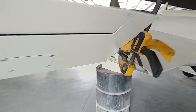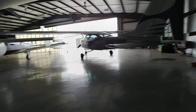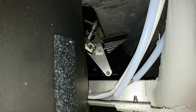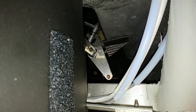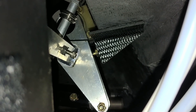I've got one of the ailerons locked all the way up against the stop, and the other one over here is all the way down — the stop hits the leading edge and it's actually touching up against there. So they're matched right now: when one side hits the up stop, the other side hits the down stop. You can see that stopper bolt in there touching my little stop bracket, so all the stops match at the same point. That's basically what we want.